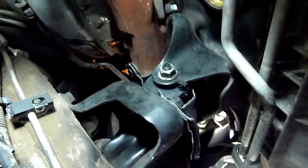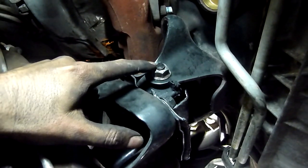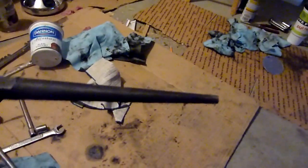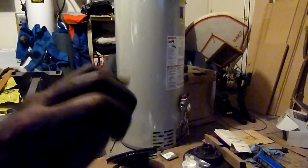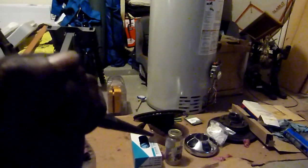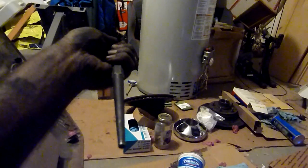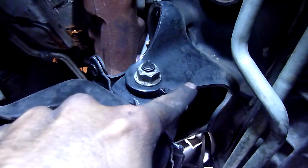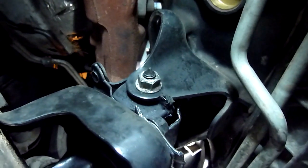One tool I found quite handy for getting the holes lined up — which I did not need on the other side — is basically a pick that is tapered to the front. You stick this into the hole and you're able to force the rubber grommet up or down to get it lined up. On the driver's side I had to do this from both the front where the bolt is inserted and from the back end as well, and this helped get that lip tight up against the notch in the plate attached to the engine bracket.